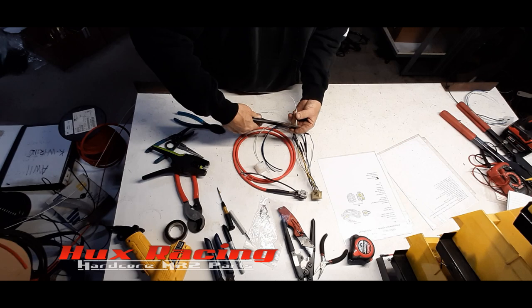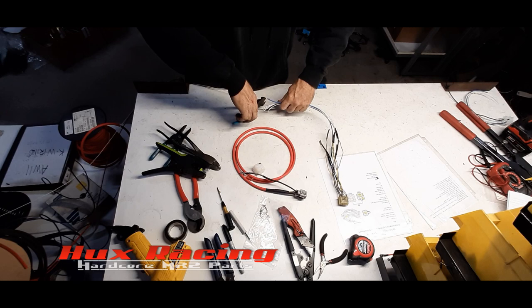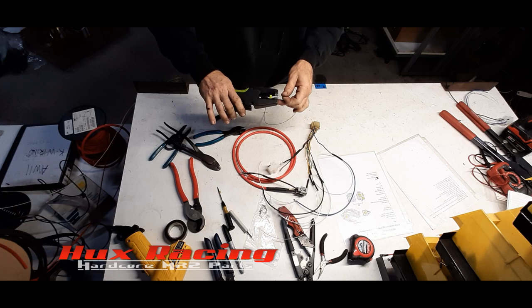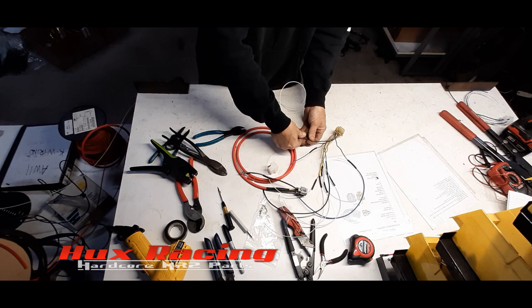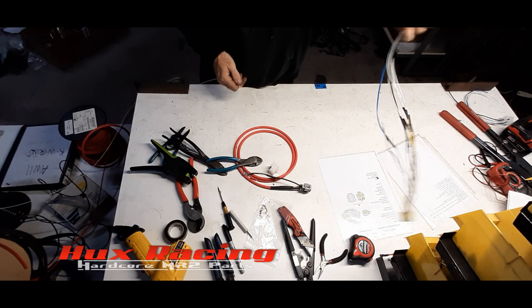Luckily, compared to an SW20 chassis harness, this is, like I say, a lot less work, but it's certainly simpler. I was really worried off of the AW11 engine harnesses or plug and play engine harness stuff in the beginning, until I realized it wasn't that big a deal. The biggest issue is the AW11 chassis harness isn't easy to remove like the SW20, but that doesn't matter if you're willing to keep that fuse box section in the engine bay, then we can certainly make jumpers and take care of everything else in the trunk.